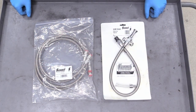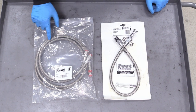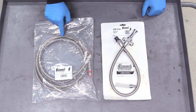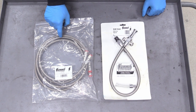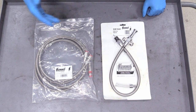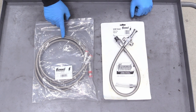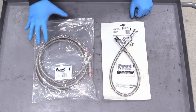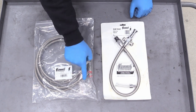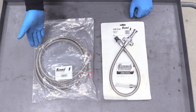So now we can focus on finalizing the little bits of our transmission. What I have in front of you are some Summit Racing automatic transmission flexible cooler lines — these are the five-foot ones, link down below in the description. If you have the stock transmission in the stock place of your vehicle and your radiator is in its stock place, you could probably just run the stock cooler lines. But if you have a custom application like us, you're going to need something like this. These are for a Turbo 350 into an older GM style radiator.